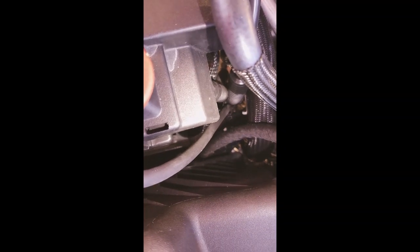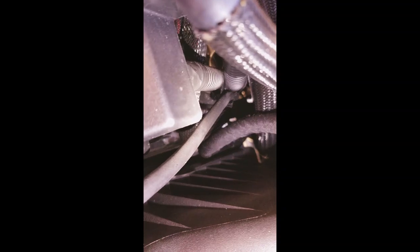One of the things you'll see when you break that zip tie off is that the cord actually has some electrical tape bundling it into the other wire harness. What I did was I just took the back side of my knife and cut that tape, and my plan is to route the cord down into the bottom of the engine.